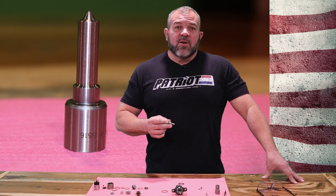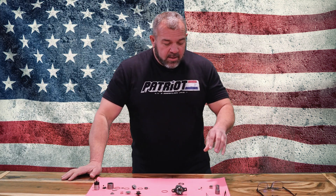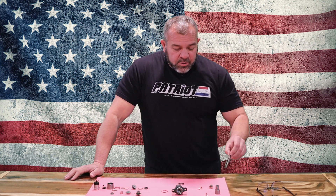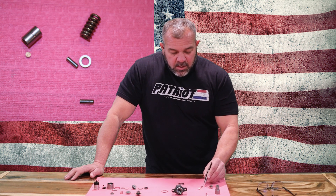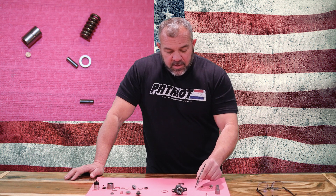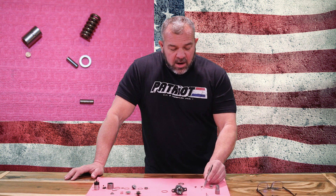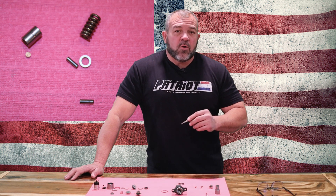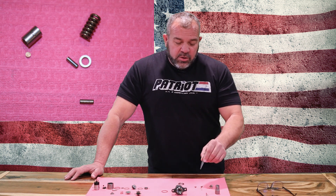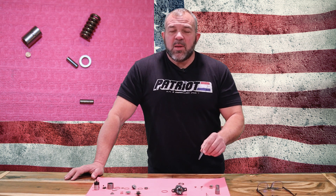Now, around and just above the nozzle there are lots of little things I'm going to point out. We've got a spring, we've got a shim, we've got a barrel holder, and we've got a DNH shim. These two shims down by the nozzle are responsible for overall needle lift and the idle travel. Those two shims will get reused maybe over half the time.